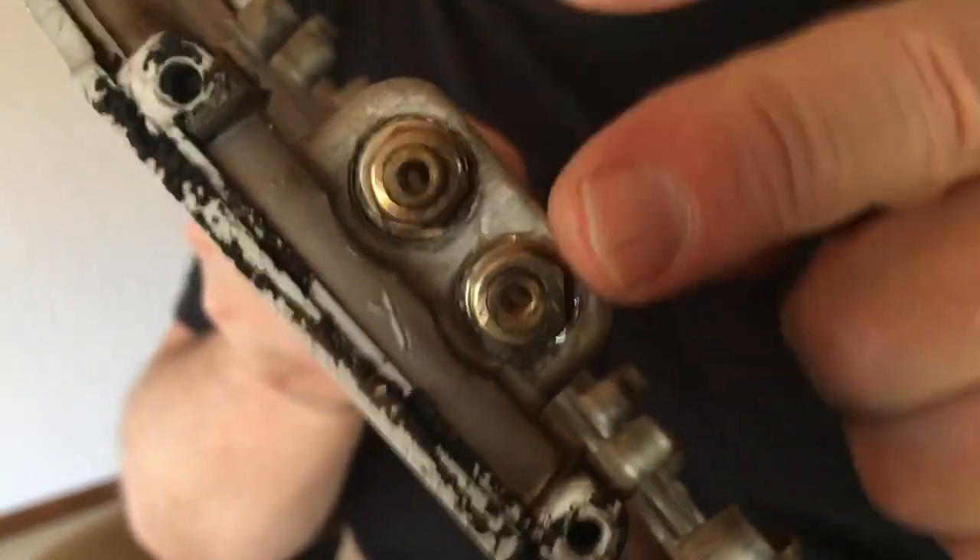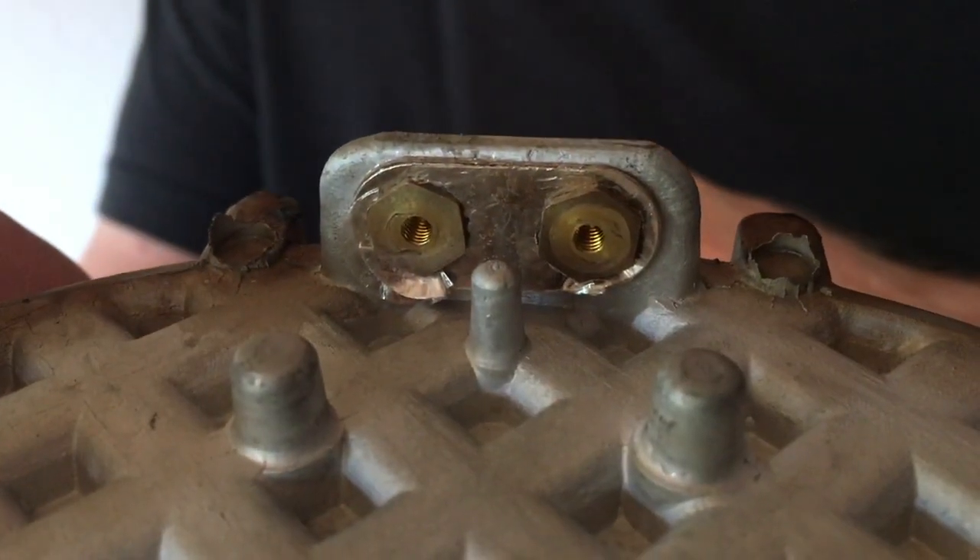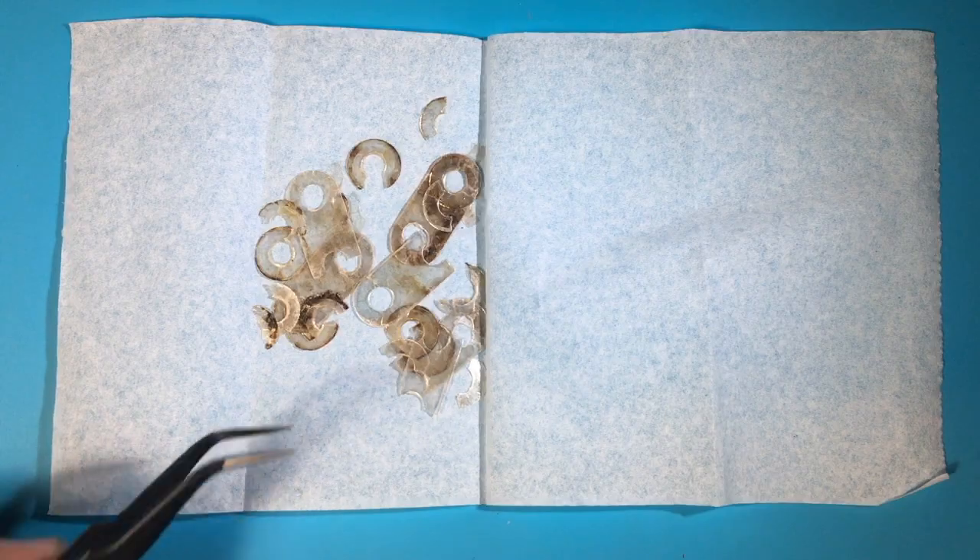To achieve that, the designers used mica as an insulator. They made mica washers and put stacks of them around each of these terminals, and on the backside there's kind of a mica gasket. Mica is basically a sheet silicate — it's effectively a stone, very thin, and it makes these very thin laminar sheets. When you're handling this, I recommend peeling the whole stack off delicately as you can as one unit. Don't try to separate the pieces because they'll break — it's really fragile stuff. Then just take a little alcohol and wipe the outside off to get the surface grease off.